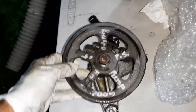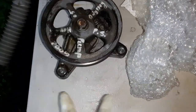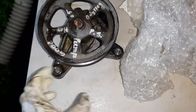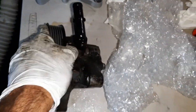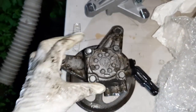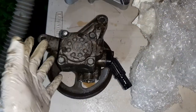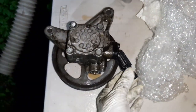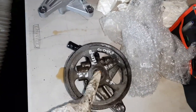Took the pump off — fairly easy, just two bolts for the 2005 and newer up to about 2010. This is the back of it — four bolts if you want to change the gasket when the pump is otherwise good. This one had already been changed before and it's not working again.